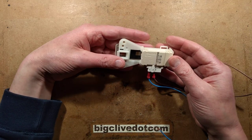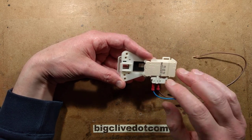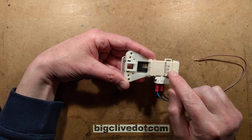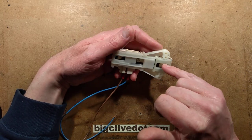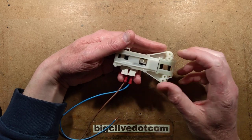Aside from the mounting, it has three functions. It's got the lock mechanism that will actually physically lock the door and stop it being opened. It's got a time delay, all done thermally in this instance. And it's got a switch contact that will only make contact when it's in lock mode and when the actual catch is in position, so it is physically locked. It's very neat.